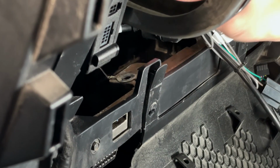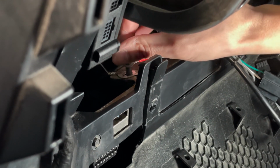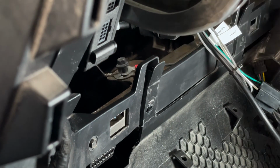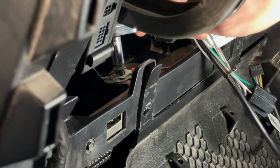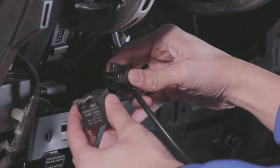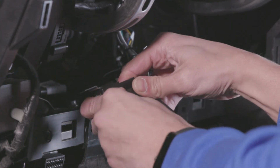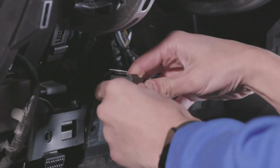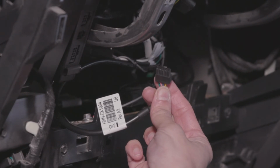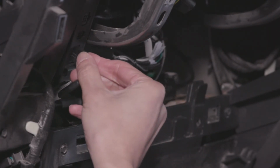To provide a ground signal for the starter inhibit relay, connect the wire with the ring terminal to a suitable chassis ground. Next, plug the relay into the relay socket. Plug the 10-pin Molex connector from the HRN CX10S4 harness into the Iox Keyless.